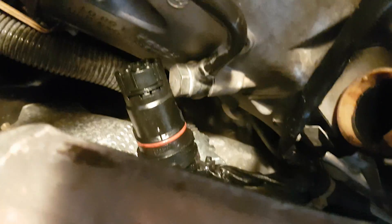That orange tab you see is the locking position — keep that in mind. Take photos of how yours looks, then slide it down. As you slide it down, the connector unscrews, and as you slide it up to lock it when you replace it, it screws the connector into the housing. That housing is unlocked with a seven millimeter socket.